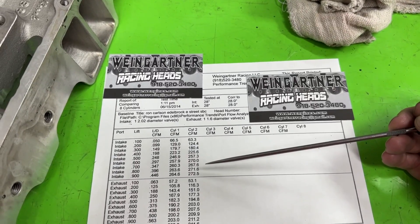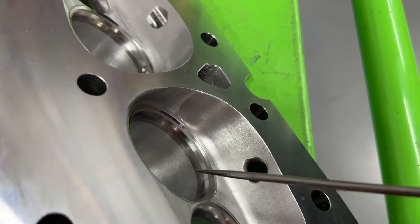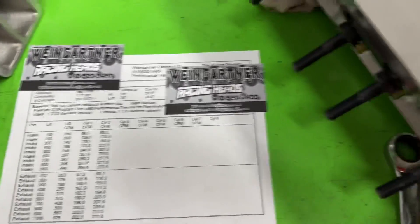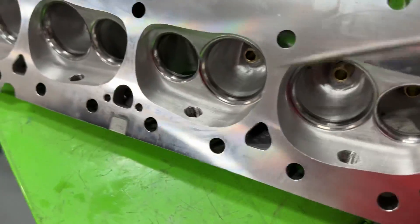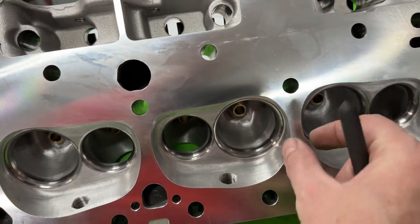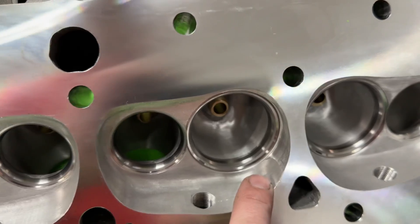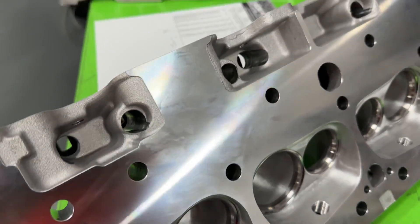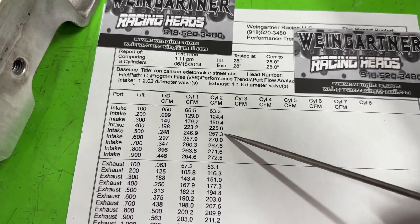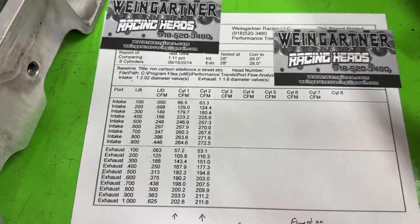What I did was cut it out to a 2.055 intake valve. The bigger reason is I got more angles into the valve job — it was really only three angles before and now I've got all five in here, which helps flow. Now at 400 lift it's 226, a gain of 3 CFM. But look at 500 — 257, almost a gain of 10. At 600 it's now 270. And that's just a valve job — I didn't do any extra blending at all. Just the valve job: 270, and it peaks at 272.